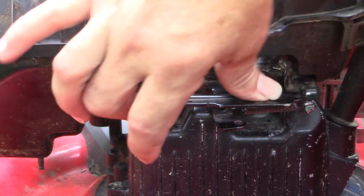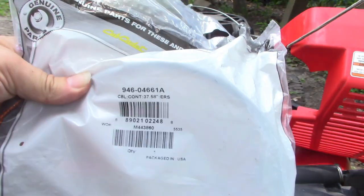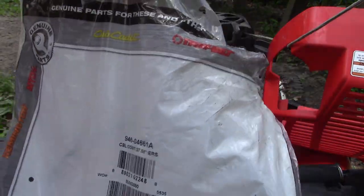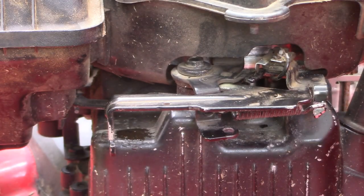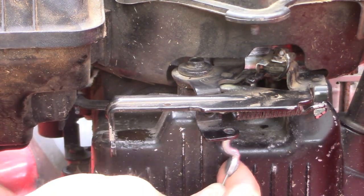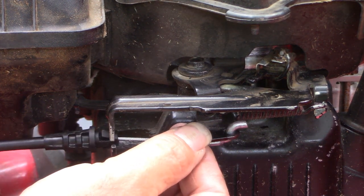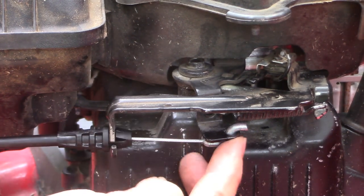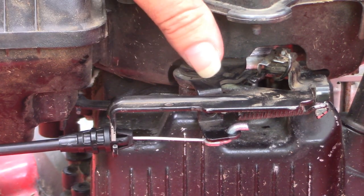Now let's connect the other end of the new cable. Here's our new cable - Troy-Bilt, Cub Cadet, MTD - it fits a lot of different mowers. I'll put a link in the description along with the part number. Installing the new cable is just the reverse of taking off the old one. This tab goes in the hole there first, then we clip it into the hole and the tabs hold it in place. At this point you could put your cover back on because you're done here at the engine.